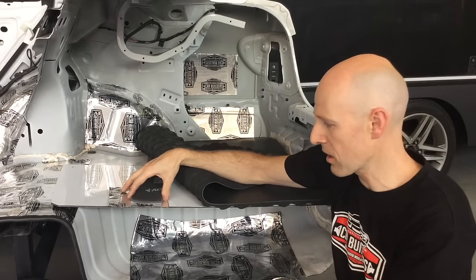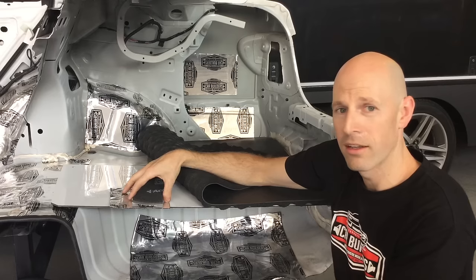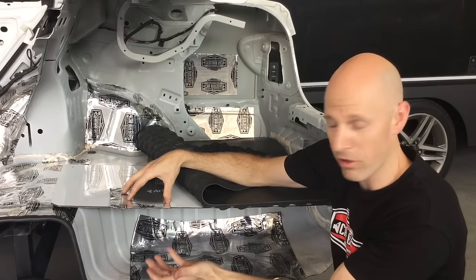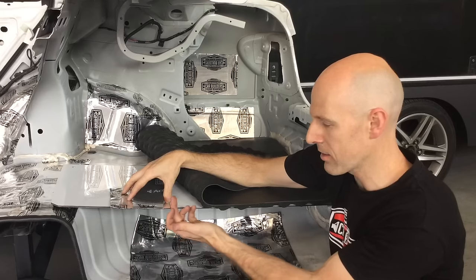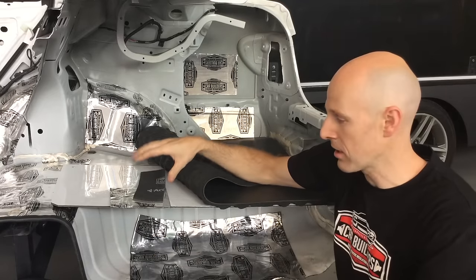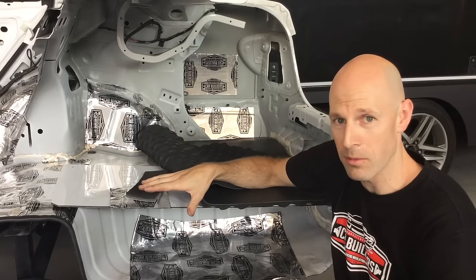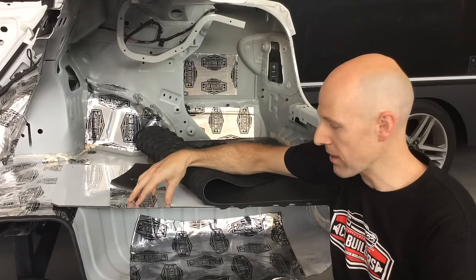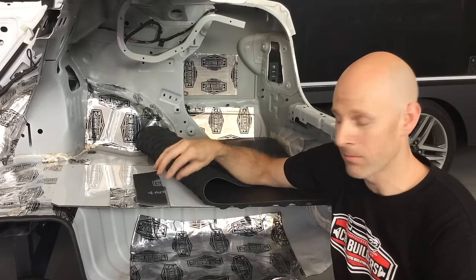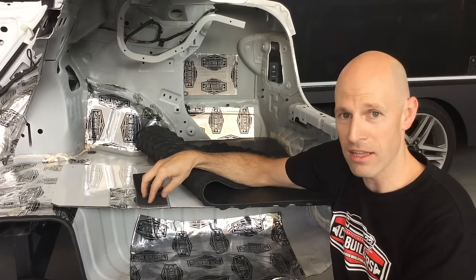The closed cell foam is also a great thermal insulator. Heat is going to come through your floor pan — especially for guys hot rodding things, putting bigger horsepower in, putting them low to the ground with bigger pipes. What's going to happen is your heat is going to go straight through your floor pan like a frying pan, straight through this rubber and hit the layer of aluminium. That's going to work as a radiant heat barrier — the heat gets dissipated and spread through the sheet. If you hover your hand over the top, the radiant heat is going to be reduced. A lot of people put this straight in the car, put the carpet over the top, and still have heat issues. What you do need to run is some form of underlay, and the advantage with the acoustic liner having a closed cell foam is you've got an additional layer that's a thermal insulator.